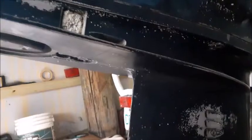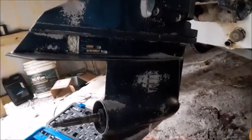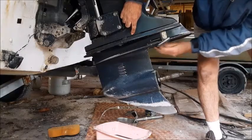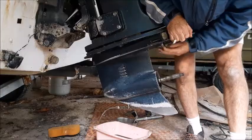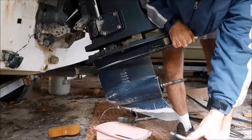There are basically six bolts holding this lower unit on. There are two on both sides, one more underneath right directly above the prop, and one that's hidden underneath this trim plate. Once you take out the bolt in the middle of the trim plate, it exposes another bolt hidden right up in the top of this cavity. I've taken all the bolts out except for the one right above the prop shaft. I'm going to spin this one out slowly and hold on to the unit as it'll start dropping the lower unit out of the mid-housing. See this gap starting to open up as I'm taking this bolt out? Okay, bolt's out.